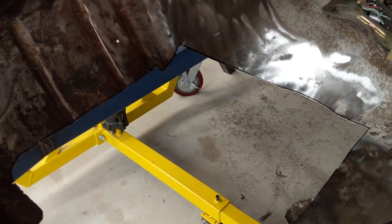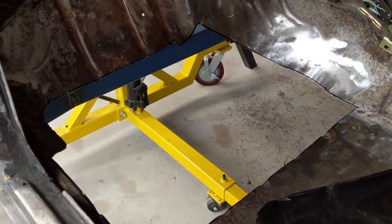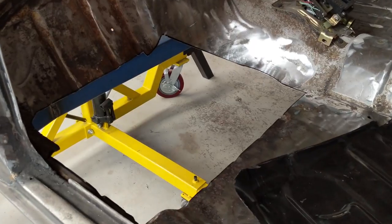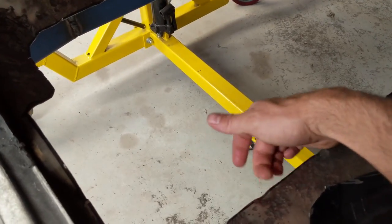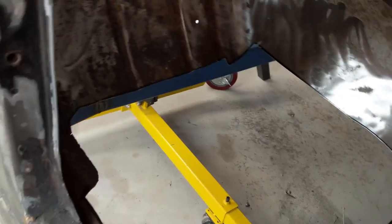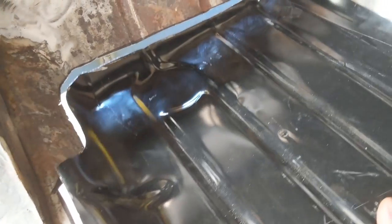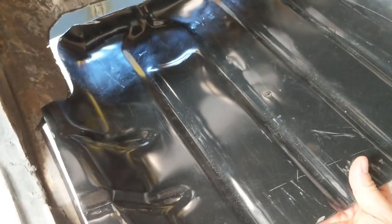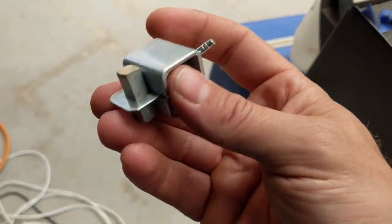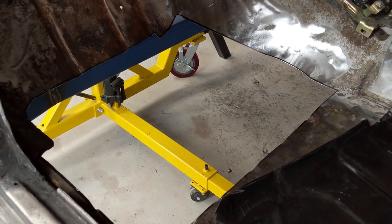That's cut out and I'm pretty happy with it, just got to test fit it now. Being a large piece in such a position, the magnets aren't strong enough to hold it. I'm going to have to fashion up some kind of bracketing system underneath with a screw — a little bit of sheet metal, one there, one there, maybe one there and one there. That will give me a brace system so I can lay the panel on top, fashion it in and get it fitted while it's resting on those braces, then use the panel clips to secure it and get a good fit before I start welding.